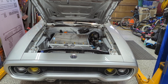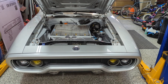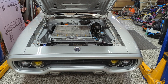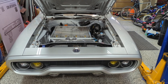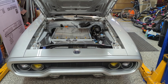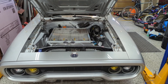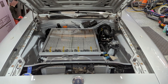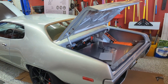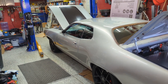As an overview: thermal management using coolant for the motor is relatively straightforward — just flow it through the motor and back through a radiator. The batteries take a little more thought and design, making sure they're all in parallel flow. For a good four-season car, you definitely want the ability to heat them — which is also an advantage for racing — and cooling them for fast DC charging using the AC to chill them. There are plenty of tools to help program, monitor, and manage the entire system. Thanks for watching — hit thumbs up if you liked it, and let me know in the comments if you have questions.